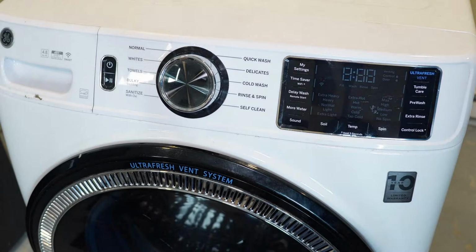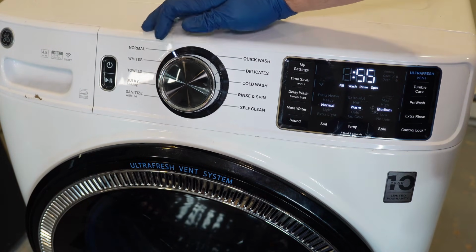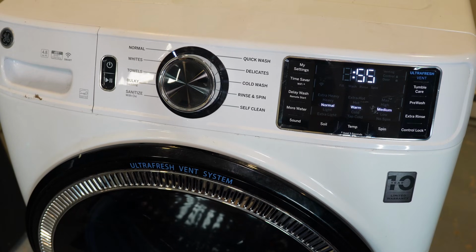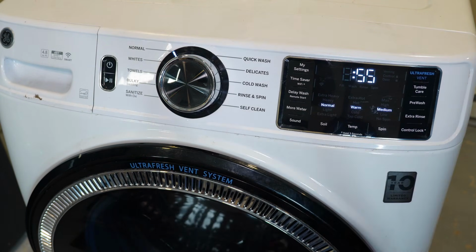I wish these machines weren't as nebulous on the fixes, and I try to go over everything that I could think of on the machine. Most issues are the main board and pump if there was a pump obstruction that made it get destroyed. Then the inverter as well. Past that, it's going to be a wire harness issue that can be difficult to trace, or some other part has failed causing the main board to be an issue.